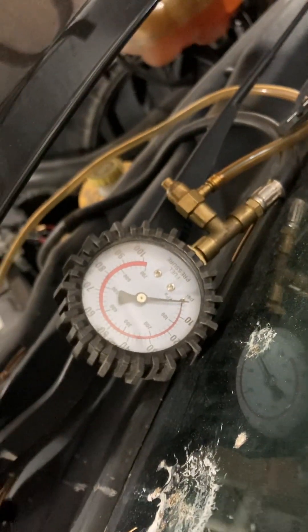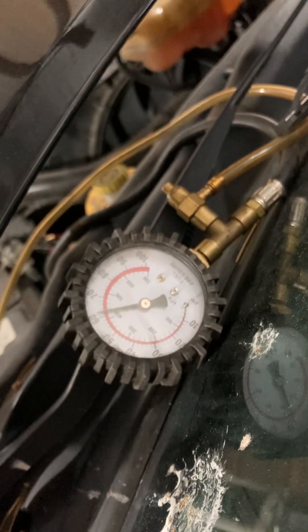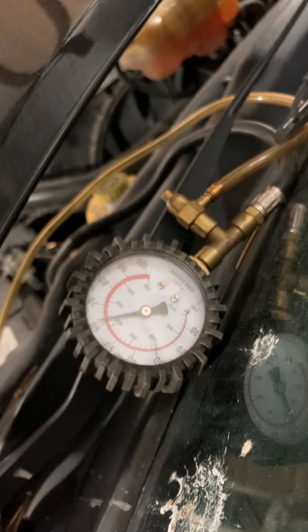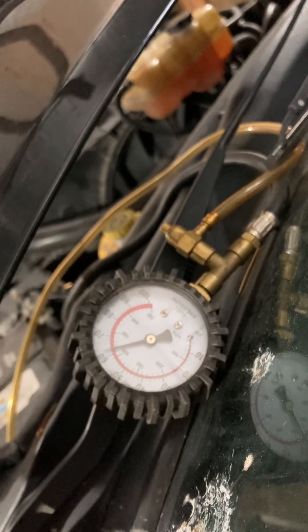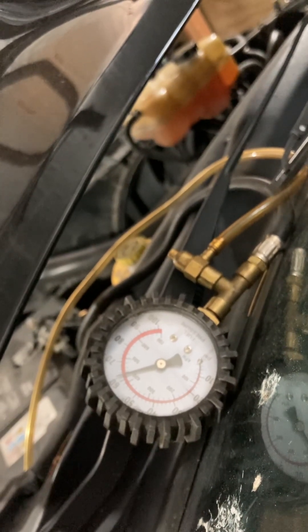With all that hooked up — I just got done replacing the lift pump in this truck — I'll show you what fuel pressure should look like. I have a fuel pressure gauge up in the dash here. With the key on, the fuel pump cycles on for about 20 to 30 seconds. With this brand new pump, I'm sitting at about 62 psi.